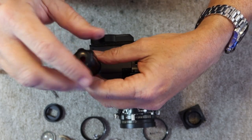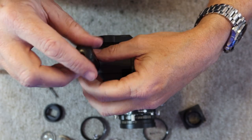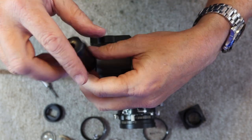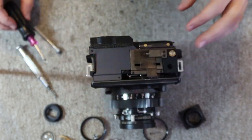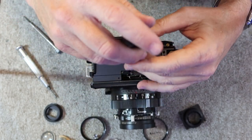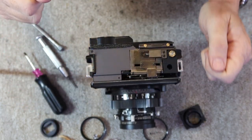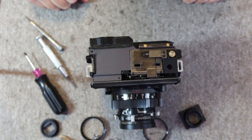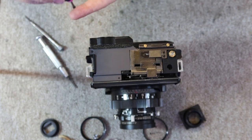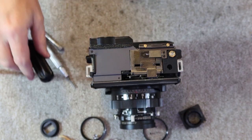I was a car guy when I was in high school and enjoyed working on cars a lot, and I remember working with friends one day trying to take the cylinder heads off of a Plymouth 340 Duster. It belonged to a friend of mine, and he kept trying to get the bolts off, and the socket kept slipping. And every time he couldn't get it to go, I would hold it on, and I would be able to get it off easily. And the trick is just making sure that the tool is exactly perpendicular to the fastener you're trying to remove.